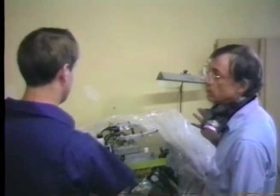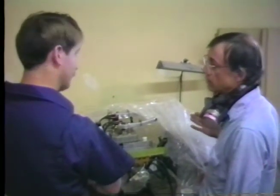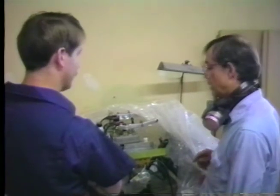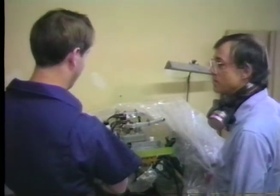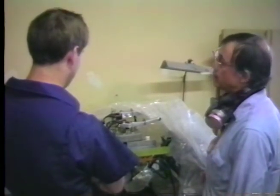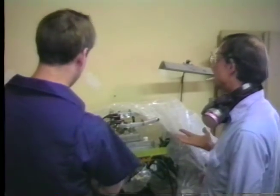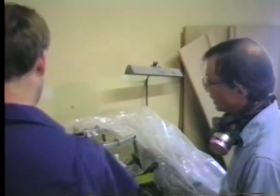I think I can make this thing run for 20 minutes or so, which is how long I'd have to let it run. And I know that I can run it faster than 185 miles an hour for 20 minutes. That's not that bad. You don't think so? How many RPMs is that? About 6,200 or so. It's really not bad. It's a little above cruise RPM. Mark Brown is turning these engines up to 6,800. He's cruising at 6,100 or 6,200. So anyway, that's the plan.